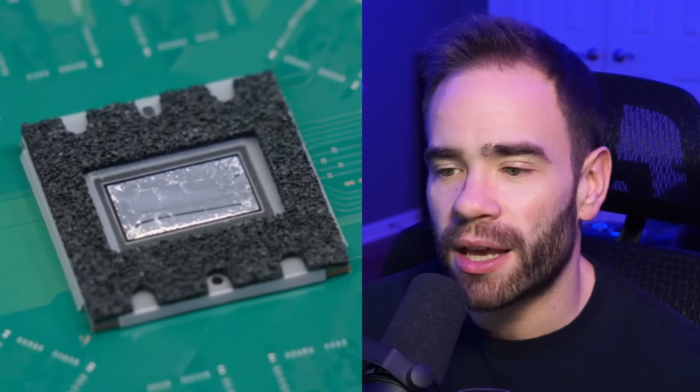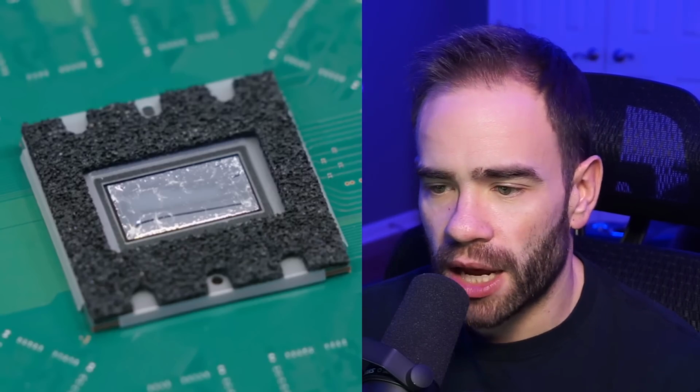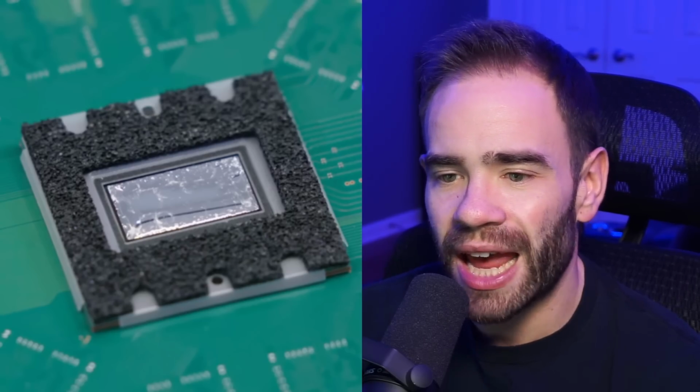So the thing that people would, I guess, have a case to be concerned about is out of the box. If you get a PS5 and you take it out of the box and it doesn't work, there is actually a possibility the liquid metal got out. I say that because while I'm sure they cycle and test these systems pretty well as they come off the factory line before they go out to stores, there is a chance that the liquid metal hasn't reacted or anything, and it could show why people are opening up PS5s and seeing this. I'm really just trying to come up with a scenario as to why we are seeing PlayStation 5s do this. And from what I can tell, it's a couple of them. It's not a substantial amount to where we are in red ring territory right now.